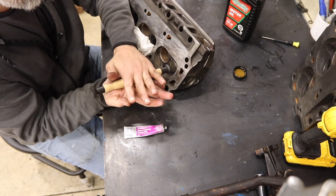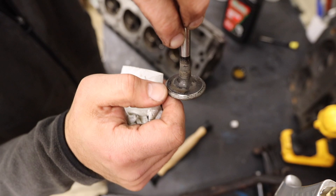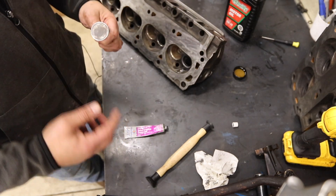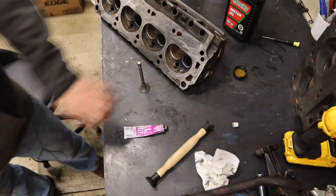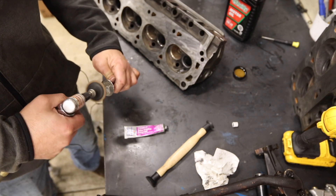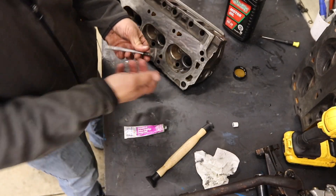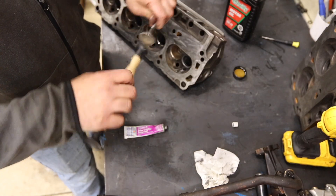It's hard to even see it. I can start seeing some shiners here, but I've got a long way to go on this. I really need to get this gunk off. I'll get my air tool and clean this face off. Now that's a high-level polish — I wasn't trying to take it to that point, but I need it just to make the valve stick. That should stick a lot better now.